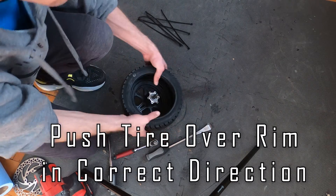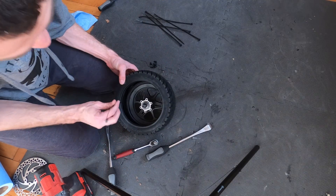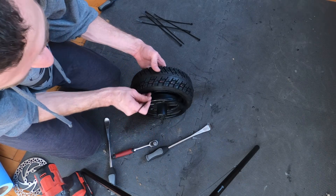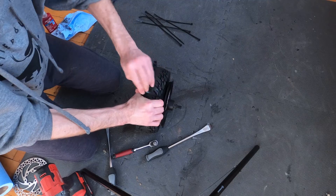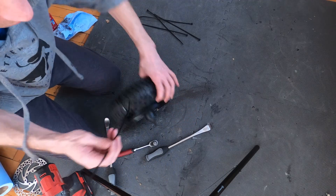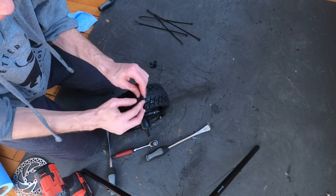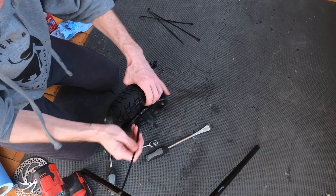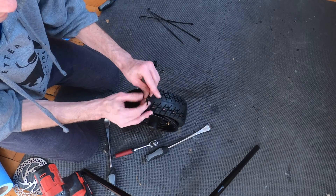Getting the tire started around the rim is easy. This is when the zip ties come into play — put a zip tie through; I actually like to go from the back side. Then crunch and smash the tire to make it concave. When putting the tire on, it'll go around the rim properly that way; otherwise you'll be sitting there frustrated for hours. That's the trick with the zip ties.